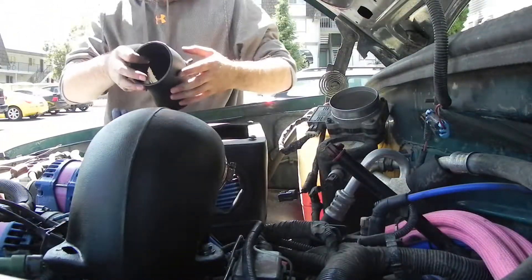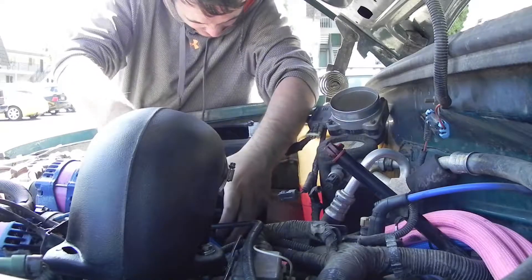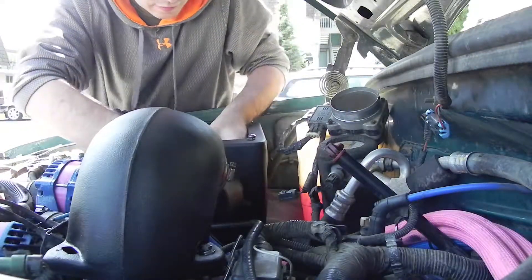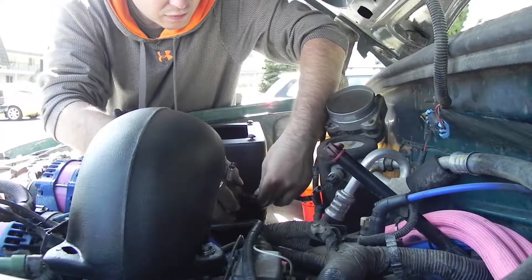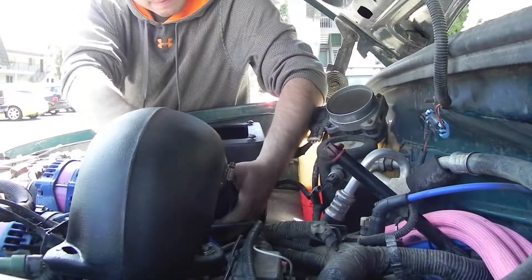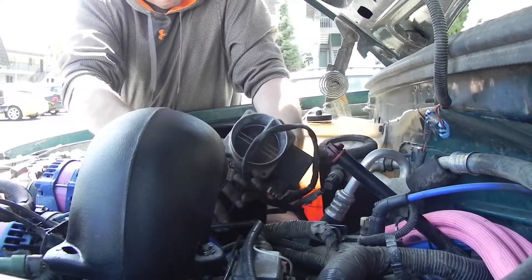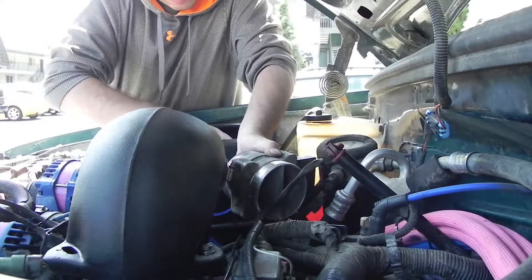Now I'm getting into actually assembling it. Here's the plastic connector piece that attaches the air filter to the tubing and to the intake horn itself. I'm sliding this into the box and attaching the filter — that didn't work out and I had to take the filter off because I didn't have enough movement to get the mass airflow sensor on afterward. Here I'm reconnecting that sensor in the little connector section. Make sure you check the direction of your mass airflow sensor because they are directional and won't work if installed backwards. I double-checked that quite a few times.